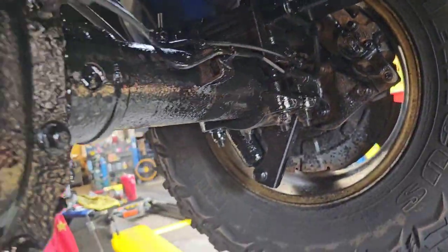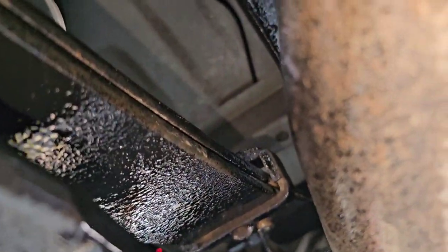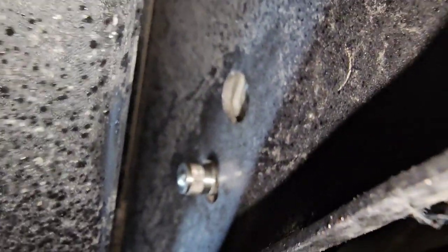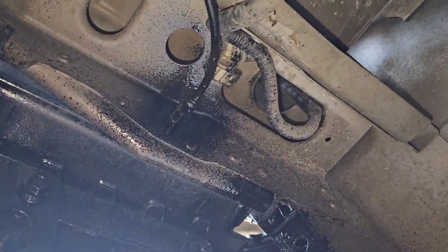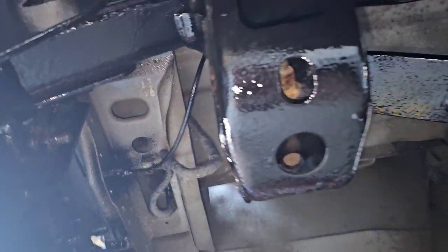It shows left and right, and I was like, dang it, I got the wrong one. So what I did was I ran my airline from the top — you see how the airline goes up, goes over the bottom of the truck, through the ribbing, comes to the back. And there are actually two bolt holes right here. I drilled one of the bolt holes out, ran my fittings through it. On the other side — same thing. Got my bag, ran my airline up through the ribbing, drilled the hole right there, and put my fitting right there. So now it's hidden.